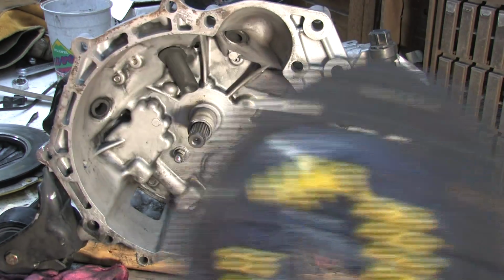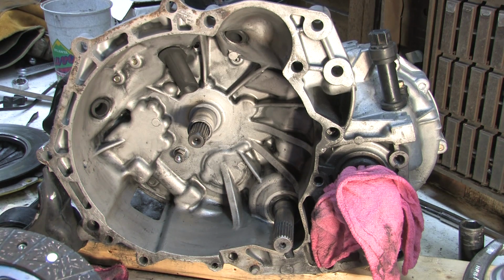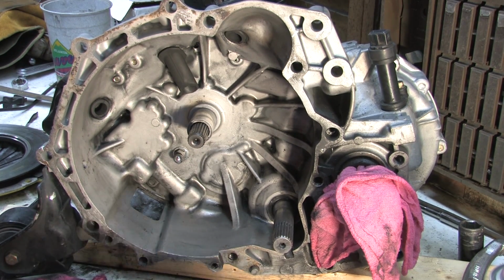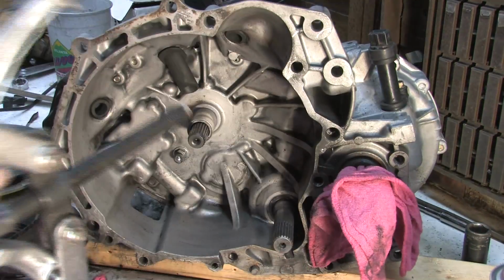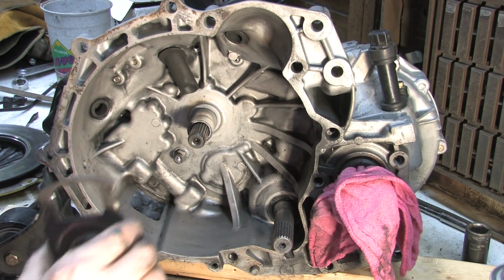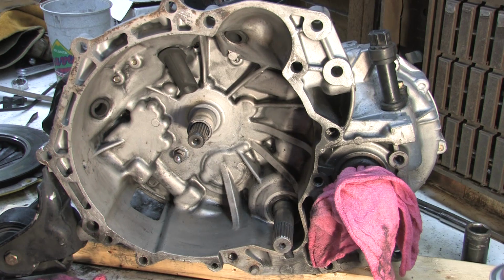But I'm going to try this street disc out, and in the next video I will cover the assembly process. And if you guys ever wind up getting your clutch disc stuck on the input shaft, at least now you can see how to get the thing off. Now, all I used was just a simple two-jaw gear puller. So you kind of have to do a little bit of cutting to do it this way, but you see I got this thing pulled off without completely destroying the input shaft.